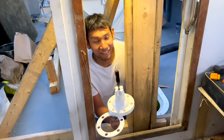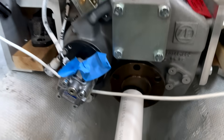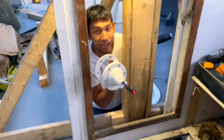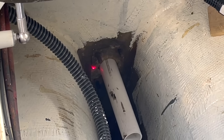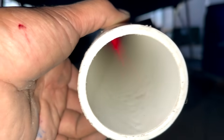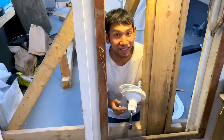Now the really cool thing about 3D printing is you can make all sorts of things. We got this special gadget — if you haven't figured it out yet, this is a laser jig. What's really tricky about this style of boat is the engine is actually aligned to the driveshaft. The driveshaft is built into the boat, and then the engine is aligned to that. This is going to go in the back of the transmission. If this laser comes straight out the backside of the engine through the boat hole in the back, it's dead center. With these little screw holes I designed, I can adjust windage and elevation and get this thing perfectly bore-sighted.